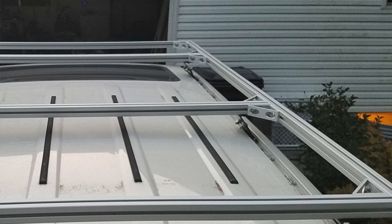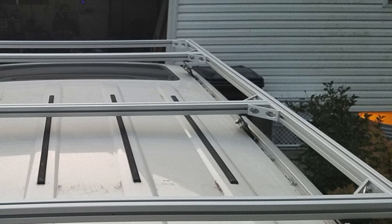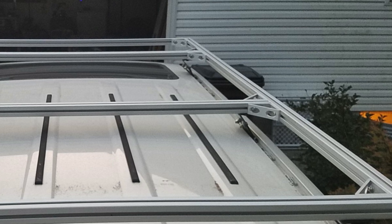In engineering, we would say it has a higher second moment of area — you know what, it doesn't matter. The point is it's a stiffer, better design all around. Several commenters have also pointed out that you can use extruded aluminum for the sides instead of flat bar or angle. This opens up some possibilities and gives you more mounting opportunities, but it does increase the cost.